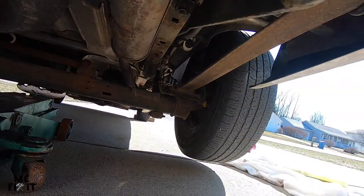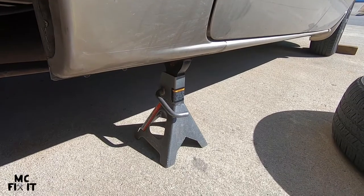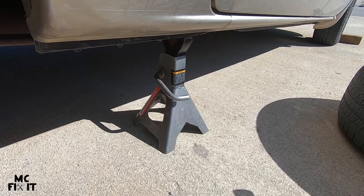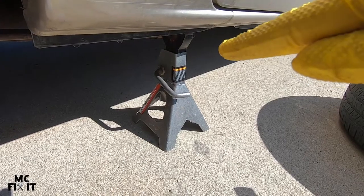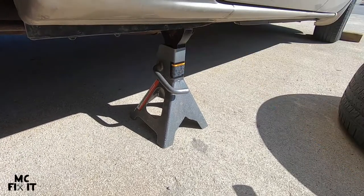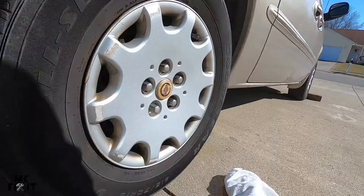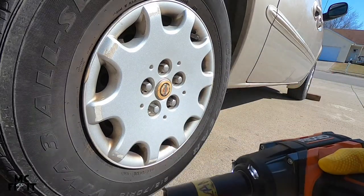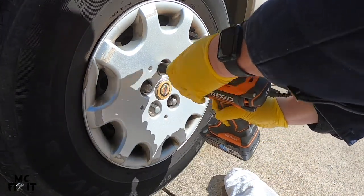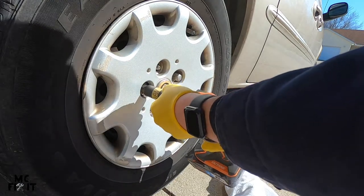You can see the tire is off the ground — pump it once or twice more. After you're done jacking up the car, please put at least a jack stand on the side where the wheel is being taken off. This helps make sure the vehicle does not fall on you. Lower the jack slightly and have it rest on the jack stand. I do prefer to keep my jack still under the car as well, just as backup support — safety is super important. Then take a 19 millimeter and get those lug nuts off. I like to go in a star pattern when taking them off and putting them on.